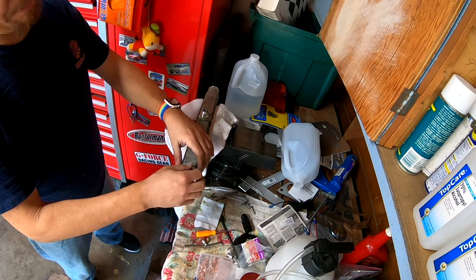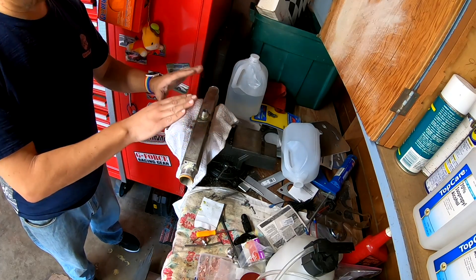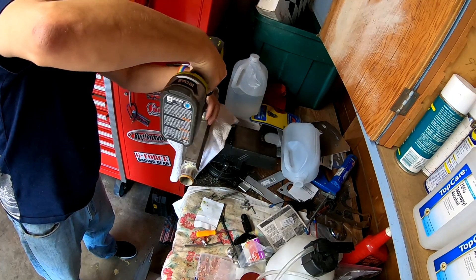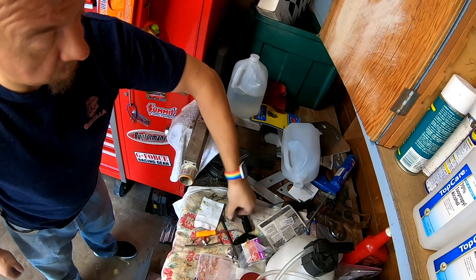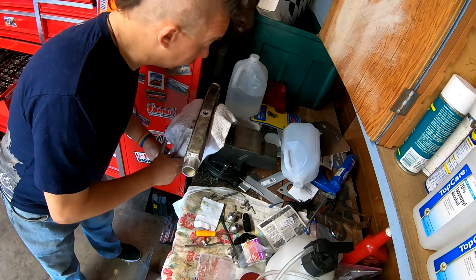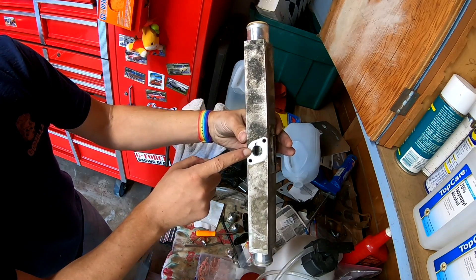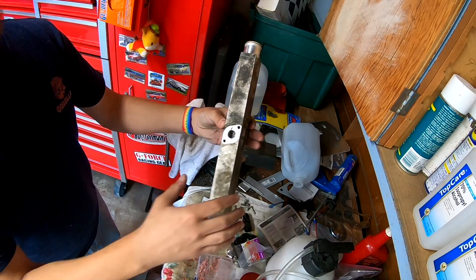What I'm doing is pulling this apart because although the water passage may be fine, wherever the oil went through there's going to be tons of contaminants and debris from the engine exploding, going straight into our cooler here. The sealing surface there looks good, our ring looks okay, and our oil adapter looks okay — but you can see debris already in there. That's what we have to try and clear out, because anything left inside when we put everything back together is just going to go straight back into the oil system.